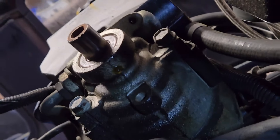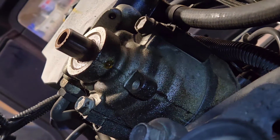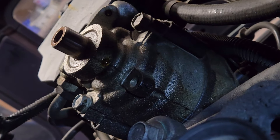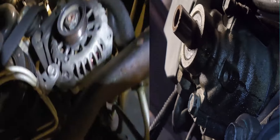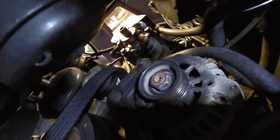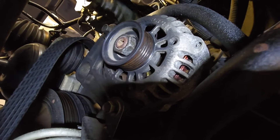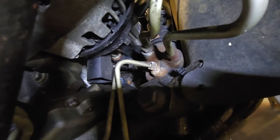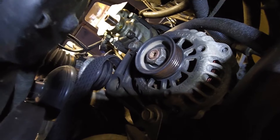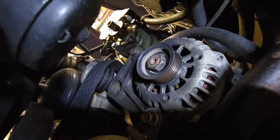Here you can see the problem: the stock pump is leaking from the shaft — you see that drip right there — getting nasty and dripping down the high pressure hose. This car only has 45,000 miles on it, so it's not a question of mileage, it's age. That stock pump only has a bushing, not a bearing in there. Because of the way everything is arranged, the power steering pump sits right on top of the alternator, so once it starts dripping onto the alternator you can literally short it out. I'm going to undo the high pressure fitting from the rack and pinion and leave everything else hooked up, hopefully walking it away so I don't get power steering fluid dripping all over my alternator — but I'll cover it with a bag just in case.